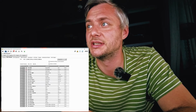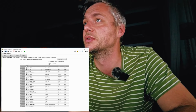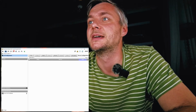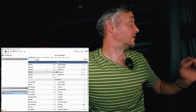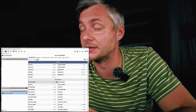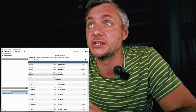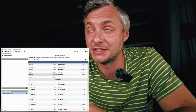Protocol, okay, and then you can tell the system which of those channels you actually want to pull from the ECU. Again, click, unclick whatever you want, and math channels, a lot of the other stuff. I'm not going to go into details, but effectively once you have that, you can connect to it, and you see all of your live measurements, because it's constantly live. If it was connected to your car and the car was running, you would see all of this, the cam sensor, the speed, analogs and stuff like that. And that's pretty much how you set it up. Again, I stress it one more time: read the instruction manual. Don't just rely on this information I'm giving you.